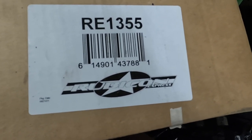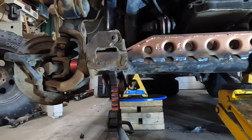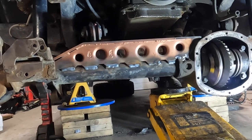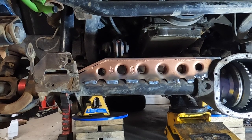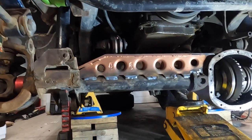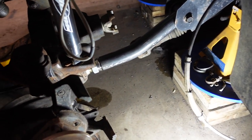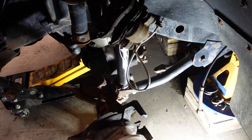I double-checked and yes, I did get four-and-a-half-inch springs for the front, where before I had four-inch that probably sagged a little. So now with four-and-a-half-inch springs I'm probably going to have to readjust all the control arms and measure the caster to make sure it's somewhere in spec — I think it's about 6.7 degrees on one side and 6.3 on the other. Otherwise if it's out you could have some serious vibration that some people refer to as death wobble, but it's not death wobble. I'm pretty satisfied with how everything's looking, so I'll get those control arms out and prop the pinion up with a chunk of wood. Removed the lower control arms so the axle doesn't roll on the jack stands.